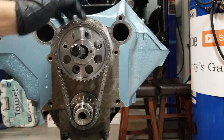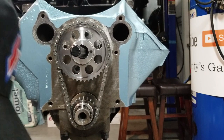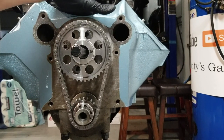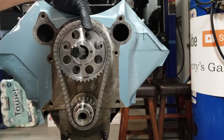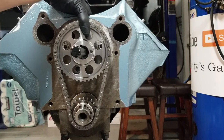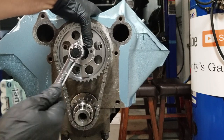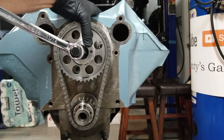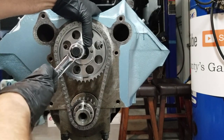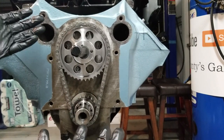It started and I can tell the key is against the back — not lined up. So what I'm going to do is take two fingers and hold the back of the camshaft journal right behind the bearings, because as soon as I turn this it's going to want to push the cam into the engine. I'm going to apply some pressure with my thumb, rotate the cam, and you'll be able to feel it engage — you might even hear it. There it is — and I can slide it right on just like that.